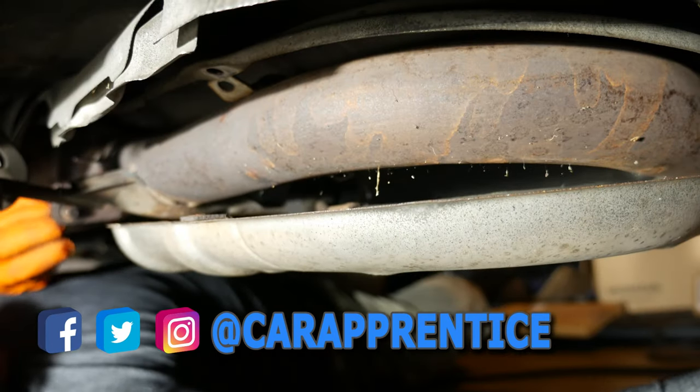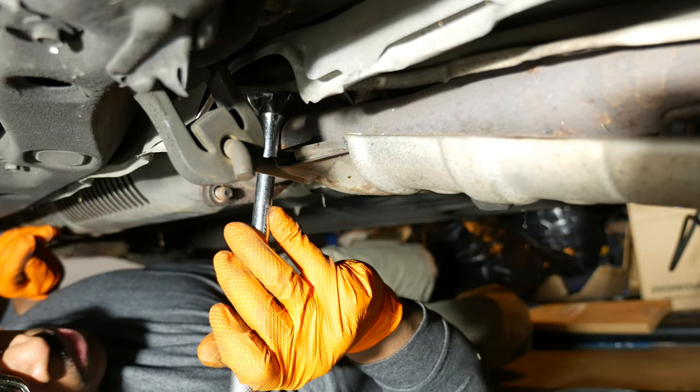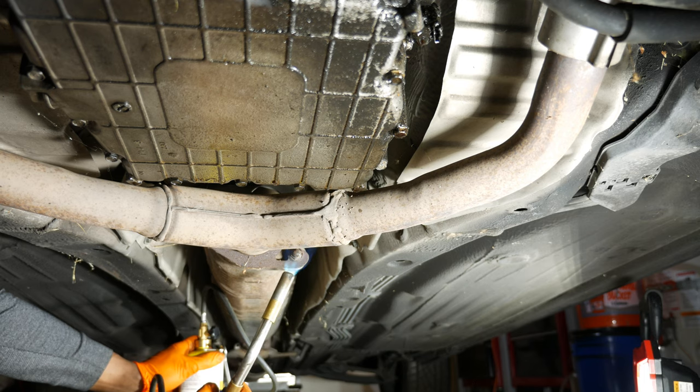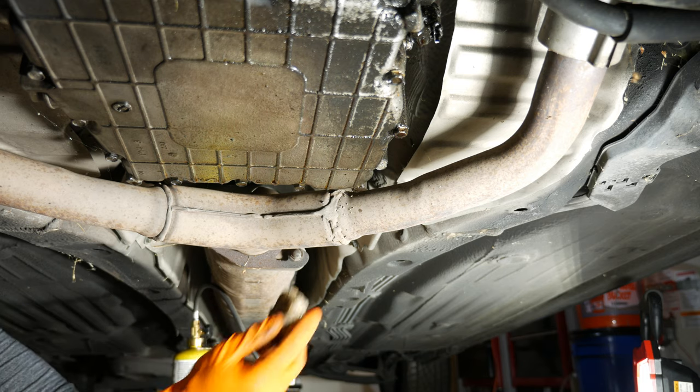The upper nut was not so easy. I had to actually separate the rear exhaust heat shield so I could reach it with the torch and beeswax and a 14mm socket on a breaker bar. With the rear fasteners removed, I turned my attention to the front fasteners. The torch and beeswax worked great in combination with a 14mm box wrench and a 12mm socket on a breaker bar to remove the lowest fastener.